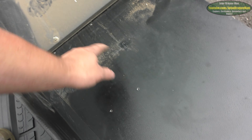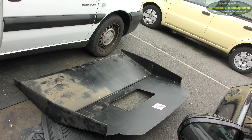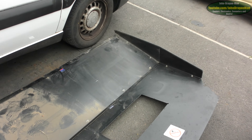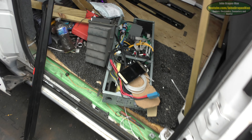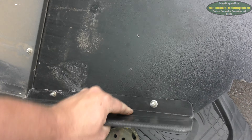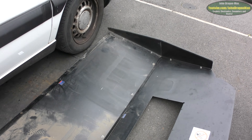There's a bit of damage done to it where they had some shelving in the back screwed into it, which is only some tiny holes. But this thing's going to get covered anyway. I can imagine how loud this was going down the road — the whole thing rattles around and it's not really pleasant. So one of my plans is to take it all apart and put some closed cell foam — just the thin 6mm stuff — in the gaps, so as it rattles around it'll make it a little more quiet. Should be nice and easy to do.